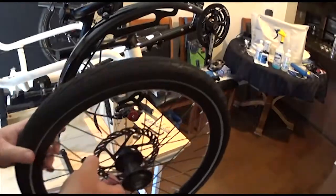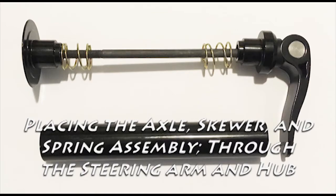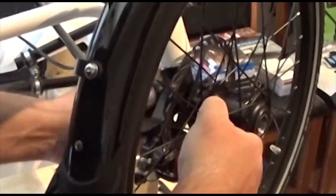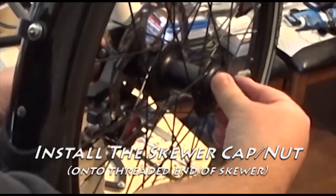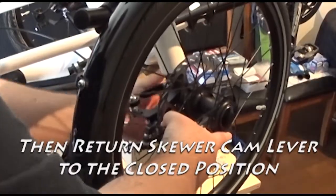After the fender is on it's time to reinstall the wheel — reinstalling is just the opposite process of taking it off. Start by placing the rotor disc into the caliper assembly. Next take your axle and skewer assembly without the end cap and slide it into the steering arm and into the hub. To get it into the hub it might require you to move the hub around a little bit until it is aligned up. Push the entire axle assembly all the way through and check to make sure there's still a spring in there on both sides. With the skewer cam lever in the closed position, completely tighten the cap in the clockwise direction, then open the skewer lever, rotate the cap a quarter turn clockwise, and retighten the skewer lever. This should provide the correct skewer tension to keep the wheel on.